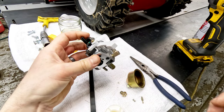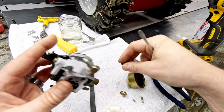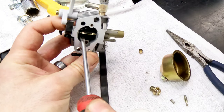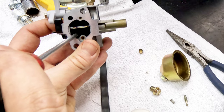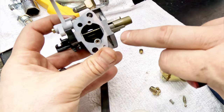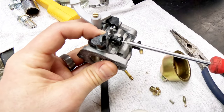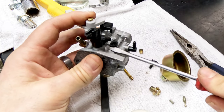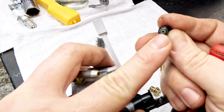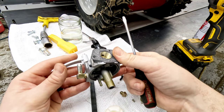When we remove the main jet, which sits straight down in here, use a screwdriver that fits tightly — you don't want it to have a lot of space or you'll strip that brass. Push real hard in as you're turning. Once you back it out as far as you can, you can lightly tap on it and the main jet will come out not stripped and not damaged. Then there's the emulsion tube that sits further down — just pry lightly in the middle and it pops straight out. We also have the pilot jet up underneath; pry that out as well. If this pilot jet is not cleaned out it'll cause surging real bad.